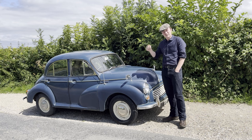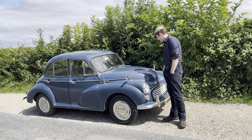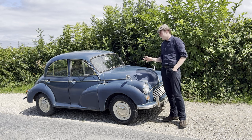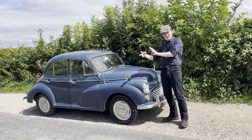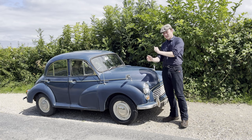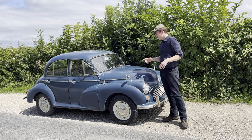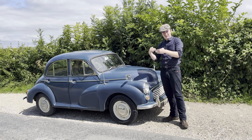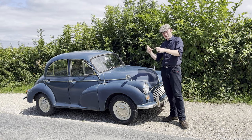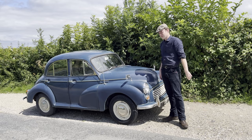I ended up getting my brother to jump on the back bumper while I was underneath to try and find where the knocking was coming from. What else is broken — clutch relay, that's been rattling and getting progressively worse on idle. It's got a lever direction changer, so when you put your foot on the clutch it pulls rods and stuff. It's got two bushes, and the rod sits between the gearbox and the frame. The bushes wear out and it just rattles around in there on idle because the engine rocks.